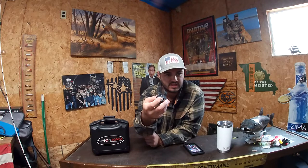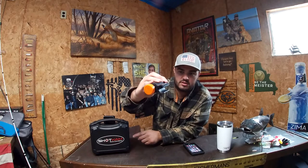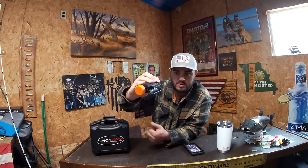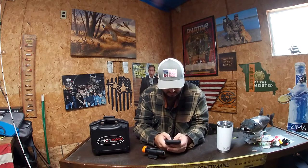First thing you're going to do is hold the button down on the back for five or six seconds to get the WiFi on. Once the WiFi is on, both lights will be orange — one blinking. Then give it a minute and one will turn green and the other will stay orange, which means the WiFi is ready to connect. Go ahead and grab your phone and connect to the WiFi.